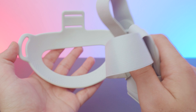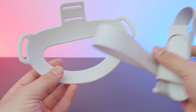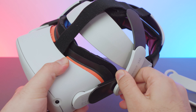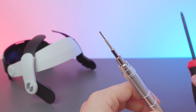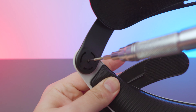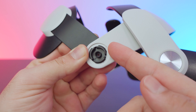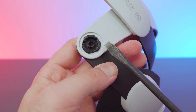Speaking of power banks — this pad with the stock strap isn't as great as the one I just showed you, but it has a special ability: if you want to install a power bank holder, you can install it on the bottom edge right here since it is more rigid than the original strap. With the M2, you've really got nowhere to place it otherwise. So how do you do it? First, take off this pad. You'll want a flathead screwdriver and a mini Phillips screwdriver — we're going to be separating this back area to install the pad. Take out these two screws and don't lose them. Bend the headset to get a nice gap and pop it right out.